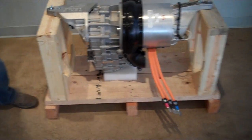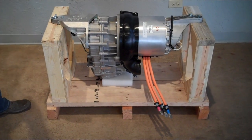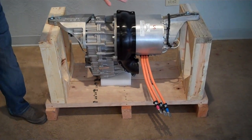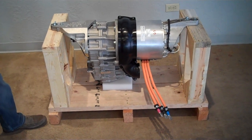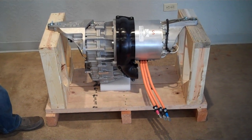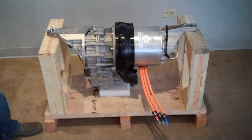I'm Nigel at Tesla in Boulder, and this is the power plant of the Roadster. This is a motor — a three-phase, four-pole AC induction motor. It's air-cooled, 215 kilowatts, 375 volts.